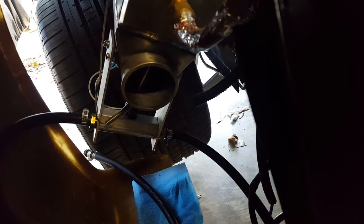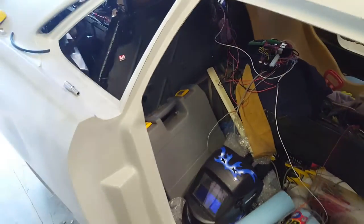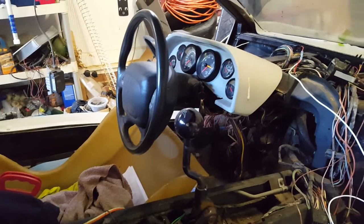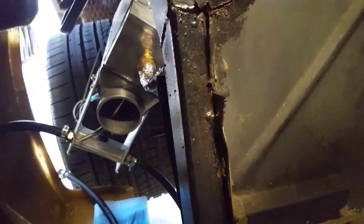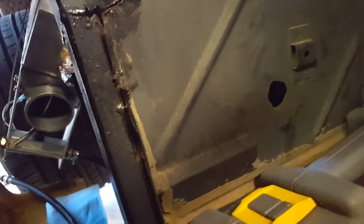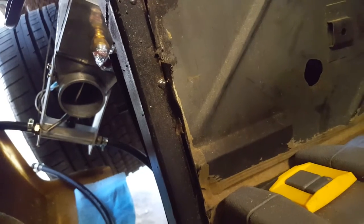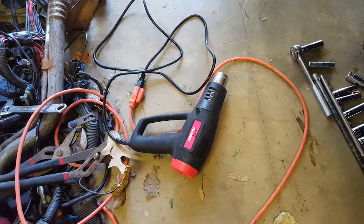That's terrible because it pools up fuel that hasn't become vapors yet, since it is just cold vapors. We're discussing things to do about preheating — this is only a problem on the first cold start of the day. My tach works now; it was moving earlier. I was looking inside the hole on the box to see the spray and I've seen fuel dripping out of the intake. I used a little heat gun on the low setting to preheat the box a bit, but I don't think that really helped.